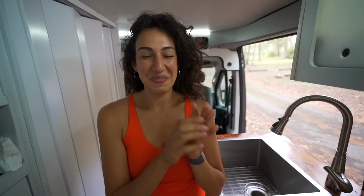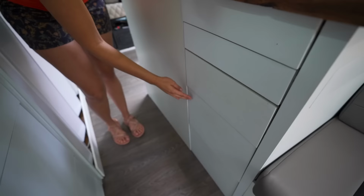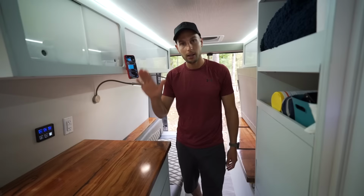We were really excited to see if it was possible to do the push to open because we hadn't seen anybody doing push to open cabinets at all during van life. And it was an opportunity to experiment and then we'd be able to bring the van back and say if it worked or if it didn't. Unfortunately, after going over a few very bumpy roads, the push to open did not withstand the turbulence. So that's when we encourage everybody to employ latches on your van and on all of the drawers, which these guys will be doing when we return the van in a few weeks.